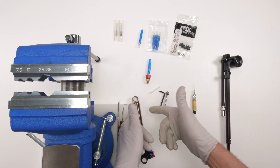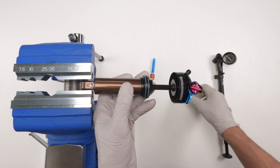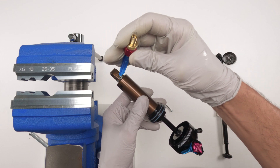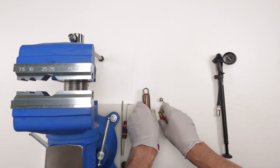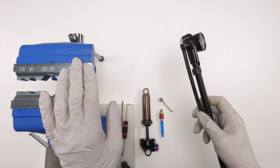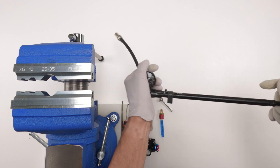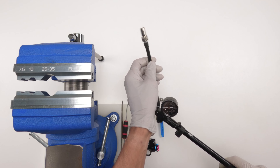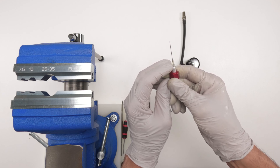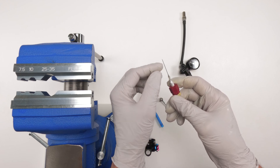When it comes to filling up the IFP chamber, we have two options. You could use a vice — strap the shock down tight and then insert your needle through the tool into the screw, and pump from above as high up as you can, making sure you have a straight line. The problem with that, in my opinion, is once you get past 350 psi this becomes a bit of a struggle up in the air. It requires a lot of pressure, which forces the hose to constantly wobble, and that's what usually breaks the tip. I put epoxy on here to strengthen the tips, but they will still wobble.